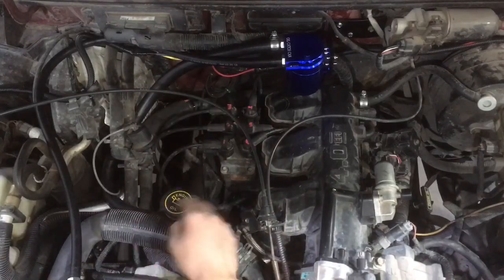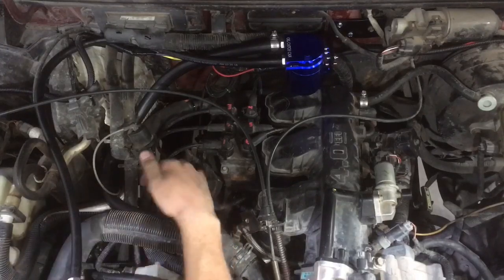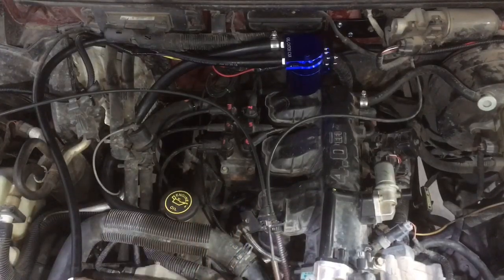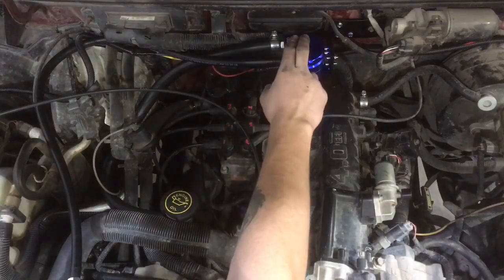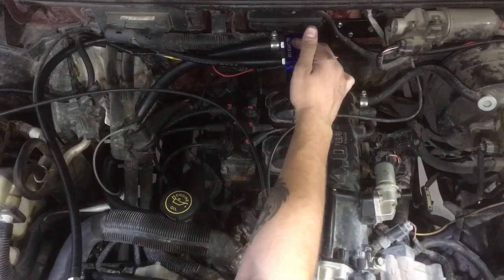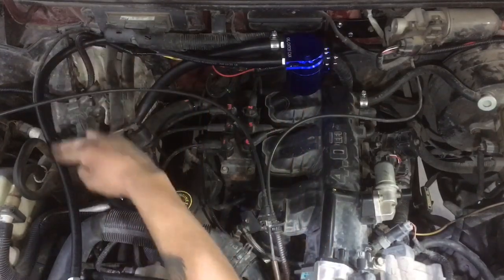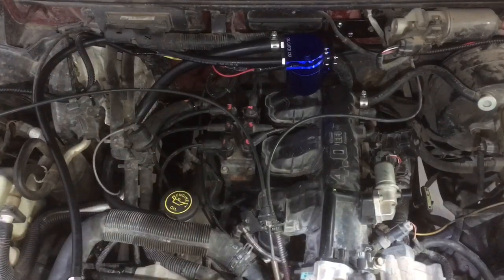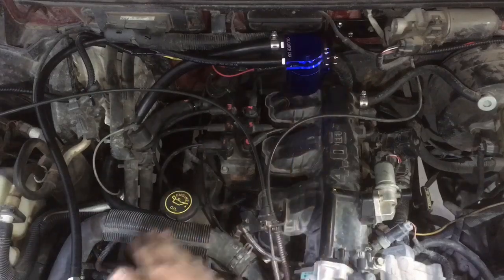This hose runs from the oil fill as your regular vent. Normally this just cycles into your intake. In this case with the catch can, this 5/8 side comes out and goes into your catch can. The catch can is internally baffled to catch the oil particles, and then the air is allowed to come back out, goes through this hose, and cycles back into your intake. That way you're keeping the oil particles filtered in the catch can so they're not re-entering your intake and going back through your motor.